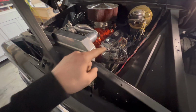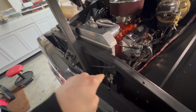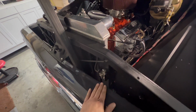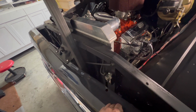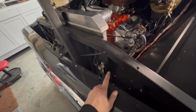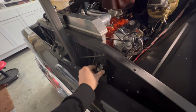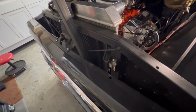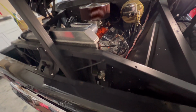Ideally, you want a 4-gauge going all the way to the battery and then another wire coming back to your relays and all that kind of stuff. But it's kind of the same effect whenever you tee it off, as long as you don't have too many things coming directly from your alternator. I think this is going to work fine. If it doesn't, then all I have to do is undo the relay from here and just have this wire connected directly to the alternator, and it's the same current as if you're running a straight wire there. So then we would just run an additional wire to the relays.